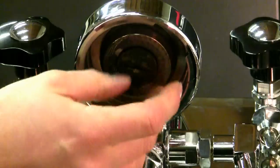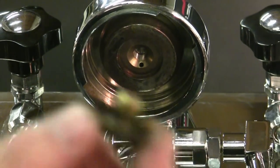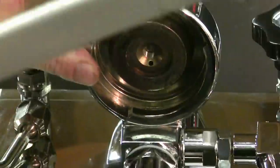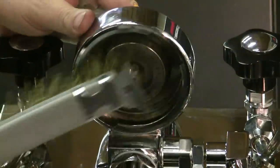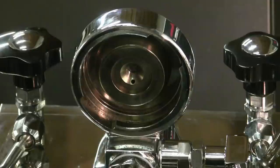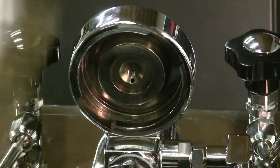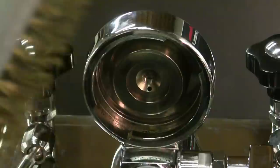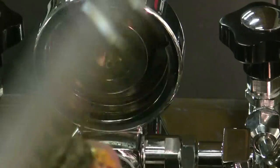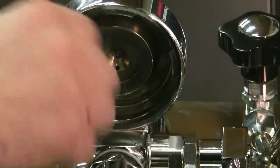Once it's loose it's pretty easy to take out. Go ahead and put this in your detergent and clean it as well. If it's really dirty, I recommend using a soft copper brush — just clean it off like that. After you've cleaned the diffuser, brush it clean as well. Make sure the holes in there are clean too. Get some espresso machine detergent — it's going to do a much better job getting into your group gasket area. Clean it all up.